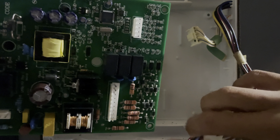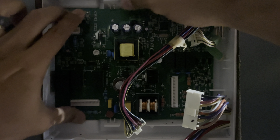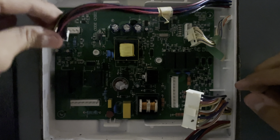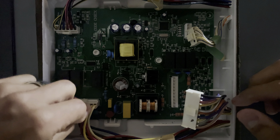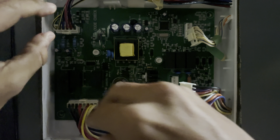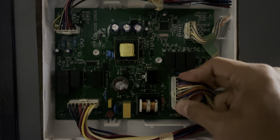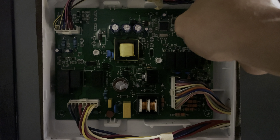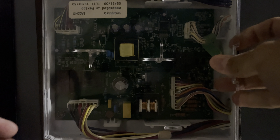Here's the aftermarket board that I bought on Amazon. I'm going to install it and show you what happens after I put the power back in. Unfortunately, after installing this control board, the ice dispenser auger would not stop operating, and it pushed all my ice to the front of the ice bin. This may cause your auger motor to burn out if your ice bin is full of ice. Now you can hear it — the auger motor does not stop.